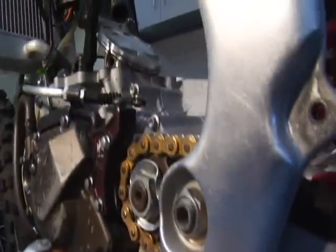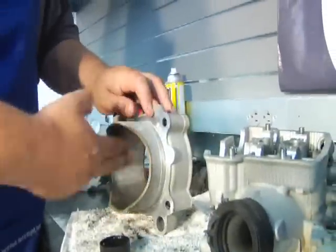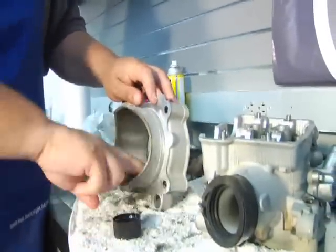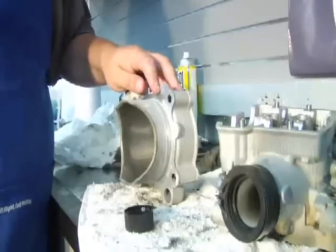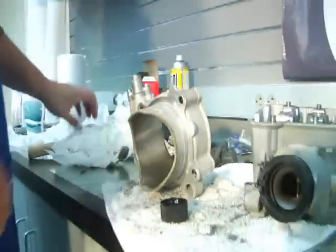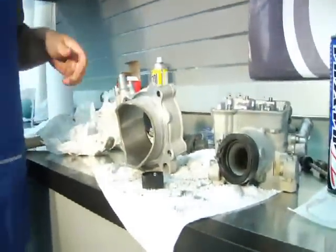All right, cylinder is getting ready. Very important tip here. Bob Oliver at Yamaha taught me this, and he's put together enough of these. Lube the walls of the cylinder upon install. It'll always help out. So that is done, and now we will put it on the machine.